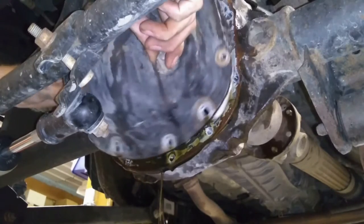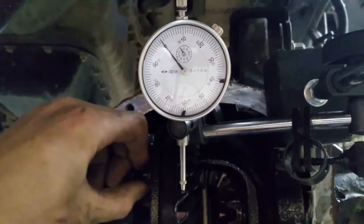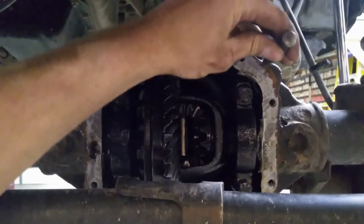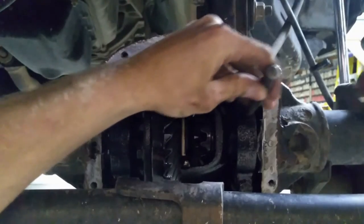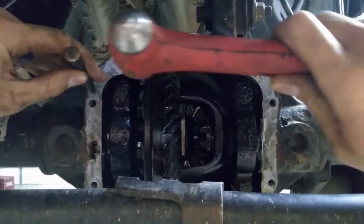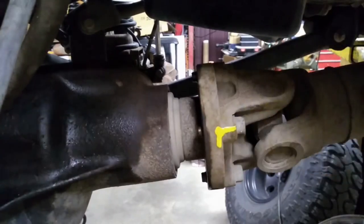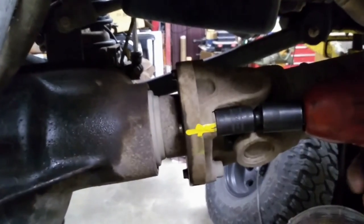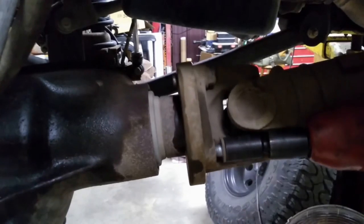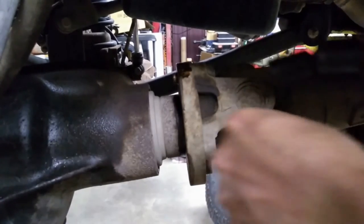I always like to take a starting backlash reading before I start any repairs. We have 8 thousandths of backlash — that is perfect. Before I take my bearing caps off, I always mark them: one dot on the right side, two dots on the left side, and I also mark the housing. When I had it all apart, I could see where someone had been in there and put marks on it before with different markings than mine. Next I want to pull the drive shaft — I always mark drive shafts before removing them so I can put them back in the same orientation and eliminate any possible driveline issues after reassembly. Once the four bolts are out it will slide right out. I always check my U-joints while I'm there — U-joints look good.